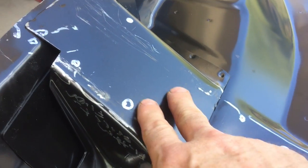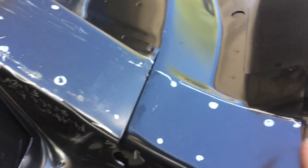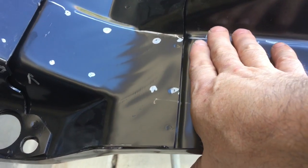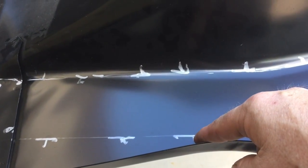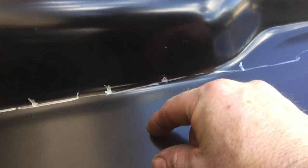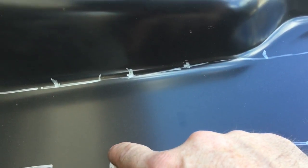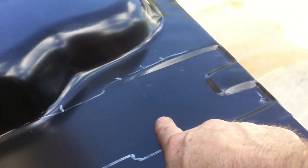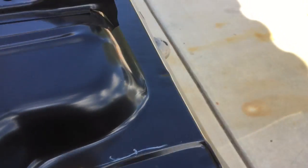Here's that bracket that we're going to go ahead and flatten out a little bit. I've also gone through and marked all my plug welds. The ones from here forward will be getting welded through the frame rail and into the crossmember. Along here I've marked the edge of the frame rail and the location of each factory spot weld, so we know how thick our flange is and we'll be able to put a hole at each mark where we need it. We'll knock this area down so our tail here kind of flips up to fit along the frame rail better.